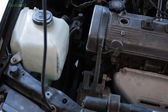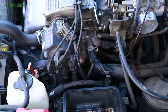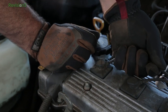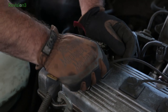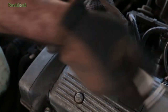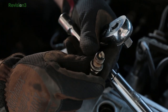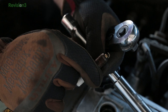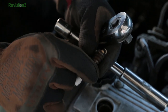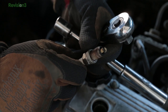So we popped the hood — just nose around and make sure things look ship shape. It's dirty under here and we'll clean it up as we go. The first thing we did was pull a spark plug boot. One thing you never want to do is lift by the spark plug cable — that's why they have this little handle. We got out our spark plug wrench and removed a spark plug. When we took a look at the first one we pulled out, it was nasty. The color on this plug is good — a nice light brown — but the electrodes are definitely chewed away. This has had a lot of hard miles on it. Reading spark plugs is something you can learn a lot about on the internet, but let's go grab our plugs, gap them, and get ready to put them in.